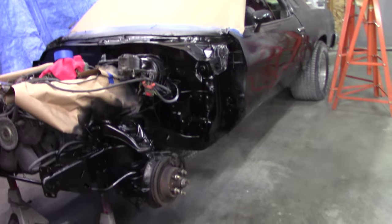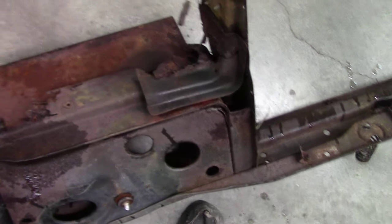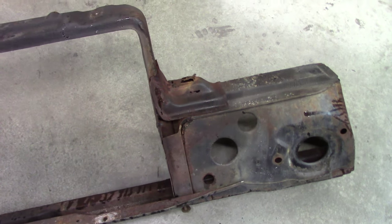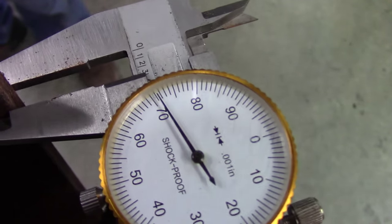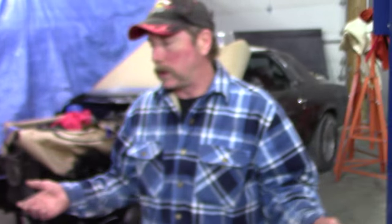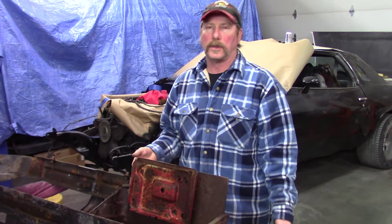We're working on the core support for the Cutlass. I've got it rusted out there with some severe rusting, and the mounting attachment has to be reconstructed. The whole thing has to be cleaned up and painted. The first thing we're going to do is get this plate out of here — it's welded in three spots. I'll probably cut it with a torch and then grind the welds. It's a quarter-inch plate — a lot of weight. It's rusted out considerably. Why don't you just go to a junkyard and buy a new one? They aren't around. Nobody saved this stuff.